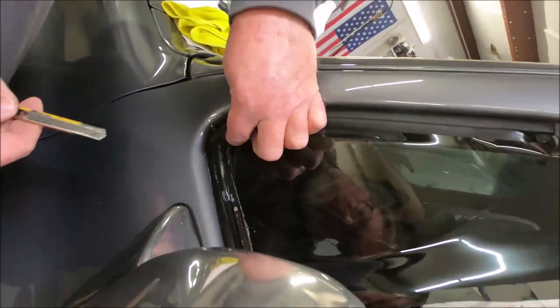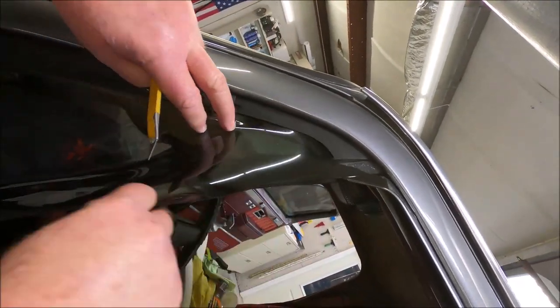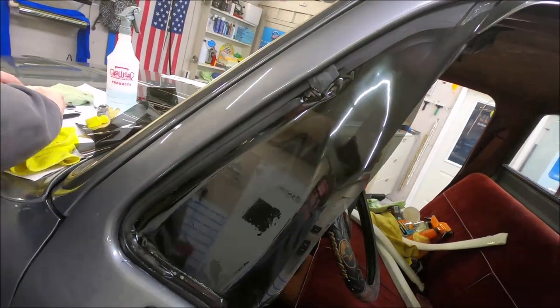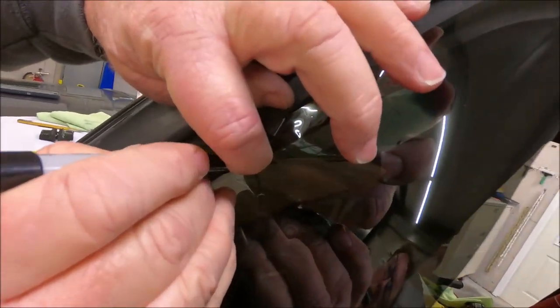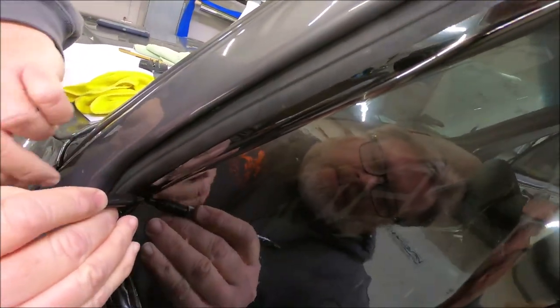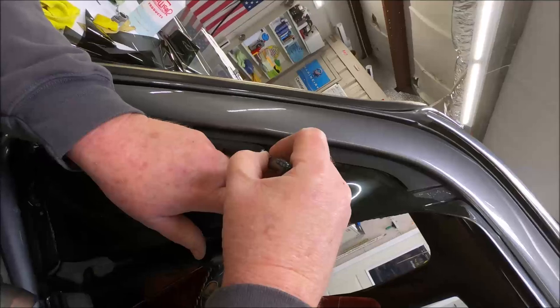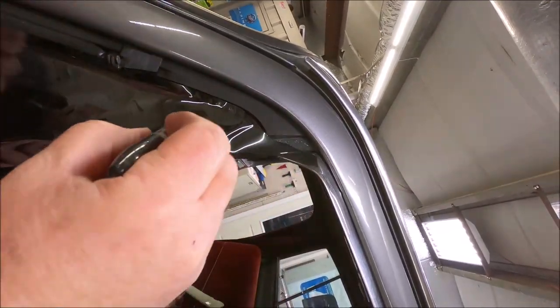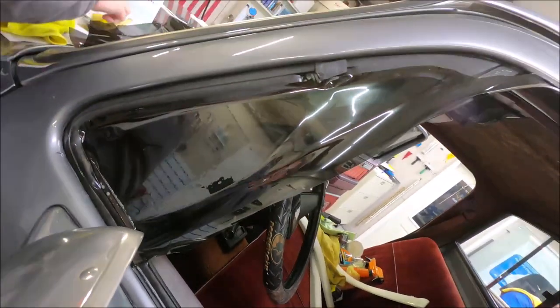Here in this curve is where a lot of people have trouble. What I'm gonna do is take my knife blade and cut a relief in it like that, so it lays down. A lot of folks will dull their blade and cause themselves grief by trying to dig this thing up in here. I'm gonna show you the correct way to do it with your knife. I'm gonna take this marker and run it right down through here to create a pattern, because I'm gonna use this lighter to shape the film. I'll ease it down through here like this — even though I'm gonna cut that, I'll explain why I was marking it.